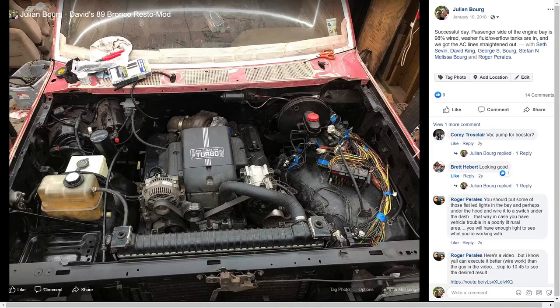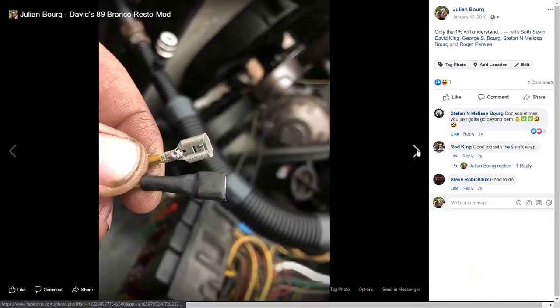The fuse box is sitting right here and the harnesses are actually tucked and running underneath where you can't see them. Here's the battery tie-down area. This next picture has a lot to talk about — you can see the hood release has been installed, all the wiring on this side of the motor is complete, the start relay is in, coolant overflow and washer tank are in, all the AC lines are hooked up, nicely loomed and taped. Here's a picture I took just to show how particular I am — every connection has been staked, soldered, and heat shrunk to ensure it's protected and will never fail.